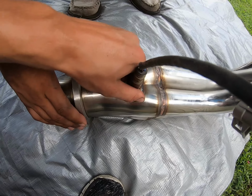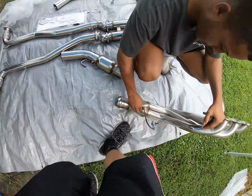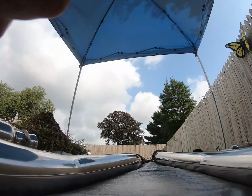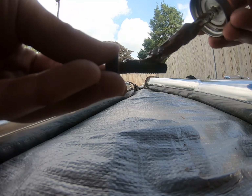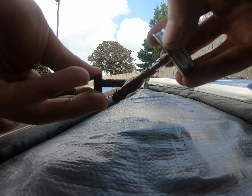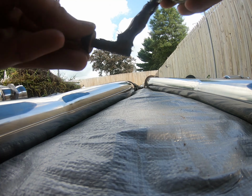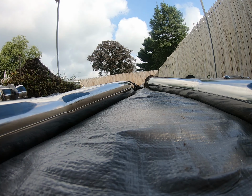Came right in, just gotta tighten that up. So why don't we just get a new O2? For each bolt, even for the O2 sensors, put a little bit of anti-seize on it. That should be the hard side. Just in case you gotta take them back off, this shouldn't ring off. Yeah, I think so.